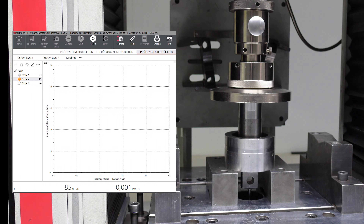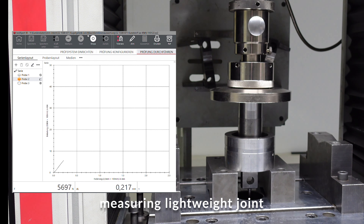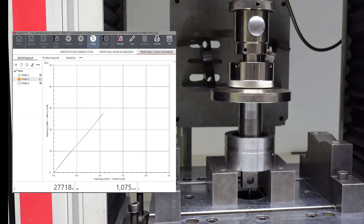Next is the lightweight design version. The picture of the testing machine looks very similar, almost identical, and again the movement is not visible because of the small displacement. On the left-hand side you can see the diagram, the characteristic of the curve — how the increase of force goes and how the deflection progresses. The characteristic itself is pretty similar to the previous one, even though it's slightly softer, but that's just due to a different rubber mixture. On the linearity of the graph you can identify that there is no crack, no slide, nothing. It works well up to 50 kilonewtons.